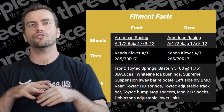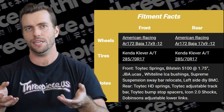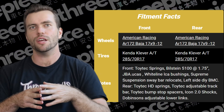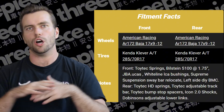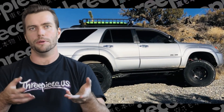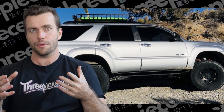The rear should not need any trimming. This next truck is on American Racing AR172 Bajas 17x9 -12 with Kenda Klever AT 285/70/17s, on Bilstein 5100s with Toytech springs, JBA upper control arms, Whiteline LCA bushings, Supreme Suspension sway bar relocation, DIY body mount chop, and Toytech adjustable suspension components all over the rear with Icon 2.0 shocks. If you get wheels that are more aggressive, you might need to do this body mount chop in addition to other mods. This truck is on a Bilstein 5100 kit set at 1.75 inches of lift, with the addition of a half inch body lift. Body lift is cheap and gives a little more room for suspension travel, but it does raise the center of gravity and creates a gap between the frame and the body. My personal recommendation is sticking with a regular suspension lift for 33s and considering a body lift for larger stuff.